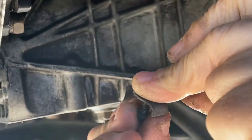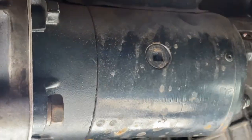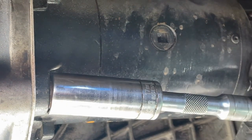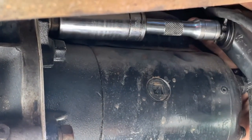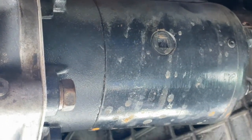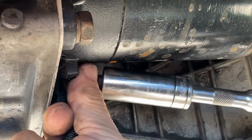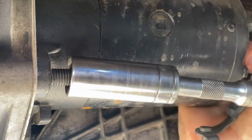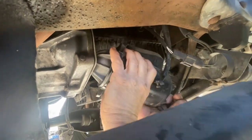Just a reminder: we already disconnected the battery. This has a really little nut on it and I don't want to lose these parts, so I'm going to spin this together and let that hang. All I have to do is take the three bolts that hold the starter to the bell housing, and with this air tool it should be pretty quick. Make sure you've got it going in the right direction. Like Mr. Fleming always says, go to the harder bolts first — that was the hardest one. When I get this last one out that starter is going to want to tip right out of there.